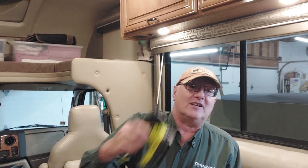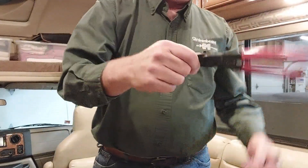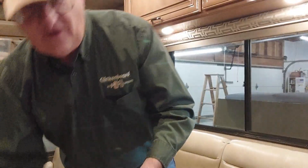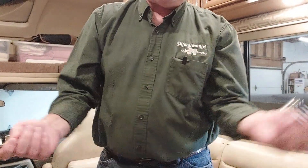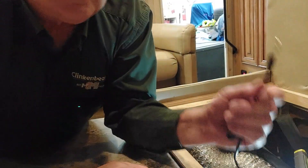We've got a plug, we're going to use an extension cord to the wall to charge the battery fully. We've got our tools out: one extra tool is a flashlight because we're in the garage and it will get very dark when we unhook stuff. Remember to unhook your battery before you work on it — I'm not going to do that so I can get light for the video. We've got a long screwdriver, wire strippers for the ground wire, and a couple of half-inch wrenches to loosen the hot wire to the battery. The RV is unplugged from the wall — no 110 volts.